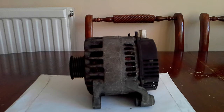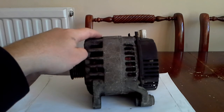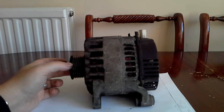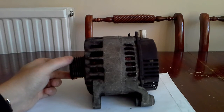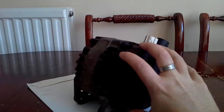The only thing that would be rev-related - where engine revs go up and you get a worse electrical problem - is an alternator. As your engine turns over, it spins and generates an electrical charge. This one is rated for 80 amps at 14 volts - there's a label on here that confirms that. However, when we tested the voltage of the battery with the engine just at tick over, we were getting up to 18 volts, which was not right at all. Most alternators have what they call a voltage regulator, housed in this part here.